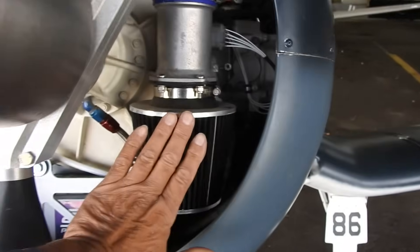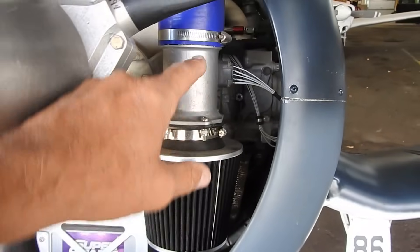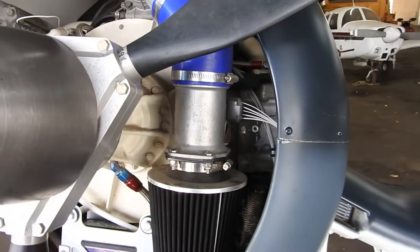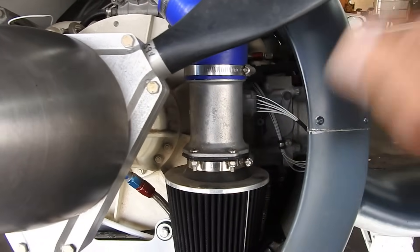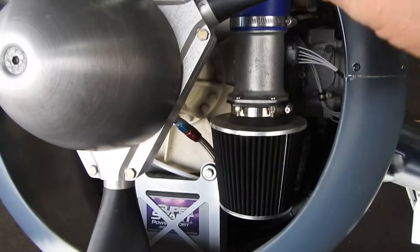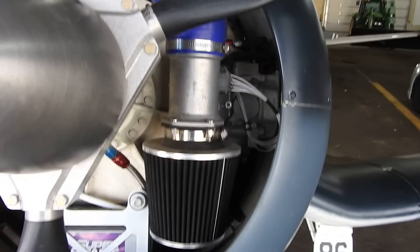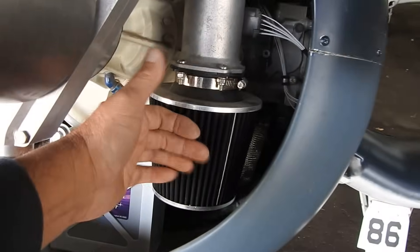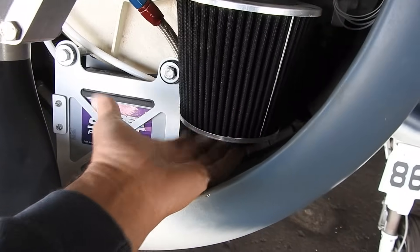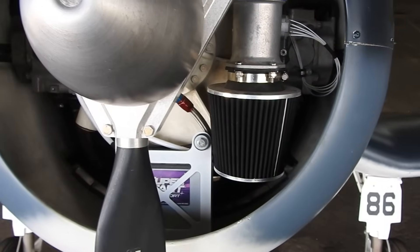What's happening is the air at 50 miles an hour is disturbing and becoming turbulent in the meter. That meter fluctuates high then low in rapid succession, and the computer sees those numbers and tries to correct for those high and low readings. What happens is it ends up running rich — and you can smell it and you can hear it. So I can't do anything today without that shield. This is a filter that's open in here too, it's pleated inside as well, but the shield's going to go on here as soon as I get it.